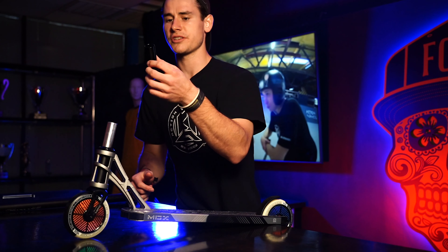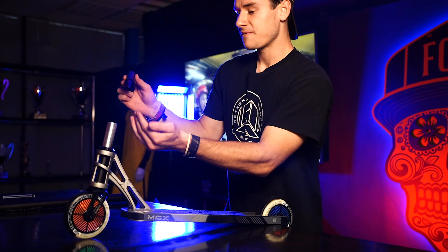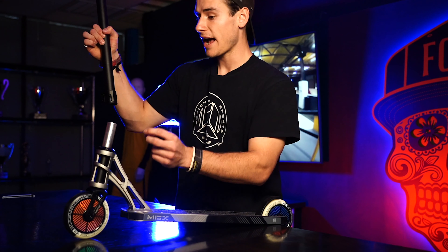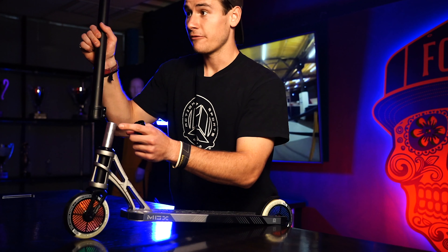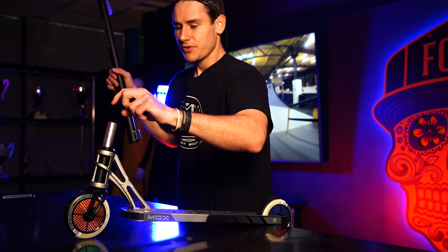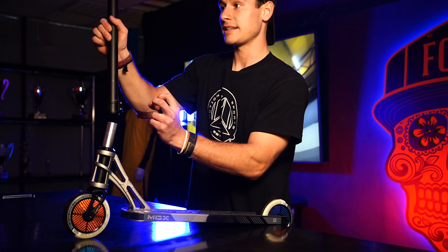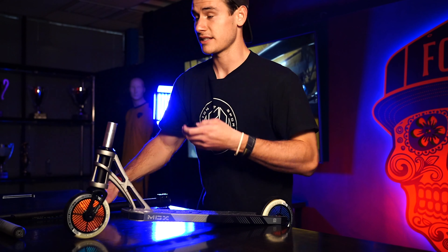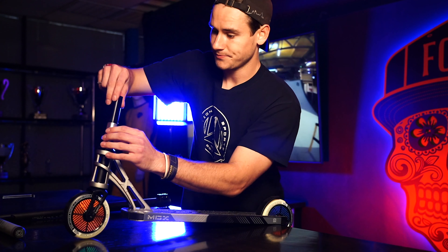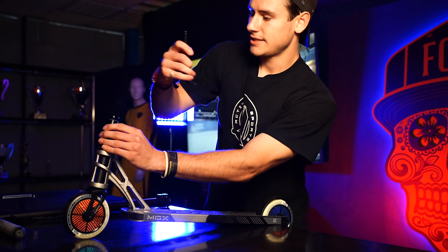Now we have our shim — here's where it gets really important. Your shim has a slit in the middle of the product, and what you want to do is make sure that slit is facing you. What that's going to do is line up with your bolts so that when everything starts to tighten, you're actually able to get some leverage onto that fork. You're creating a compression to attach your forks to the top cap bolt to the compression bolt, then we slide our bars on top and tighten all that together. Make sure the slit is facing you — you can see there's a little bit of an edge, make sure that's on the bottom. Slide that on top of the forks and throw that compression cap on top. Tighten it up.